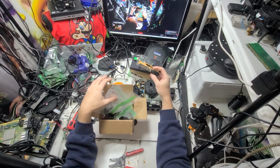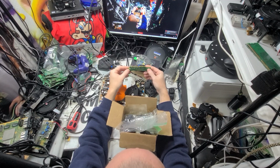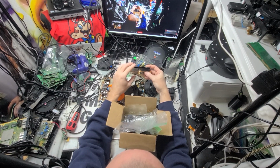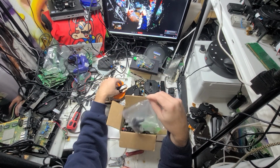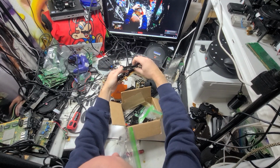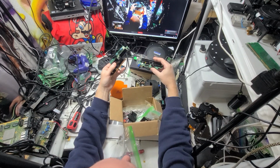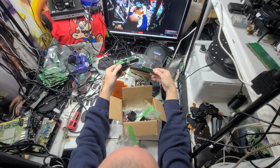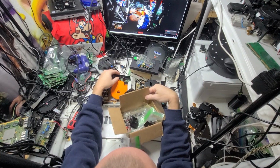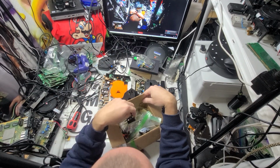All right, so anyway, then here, still sticking with the Dreamcast concept here. So these are mine, I did. How bad they are. I'm the worst at soldering ever. So you have to replace all these, especially the battery point. So I played around with them one day. It's a really bad job, but I got three of them that I haven't retested yet. One of them I didn't finish. This one, I don't think I finished this one. Oh no, I think I... those should work. If tested correctly. And you have to have a fan on there, because if you don't have a fan on there, you'll get no video.